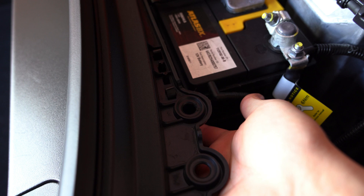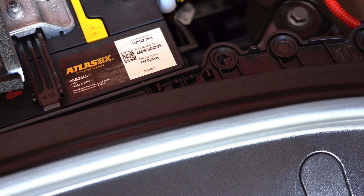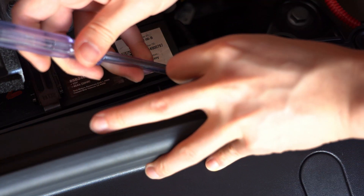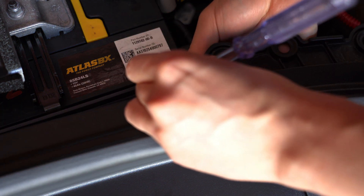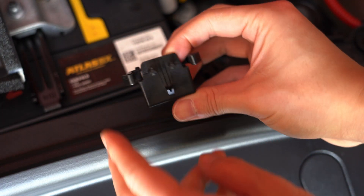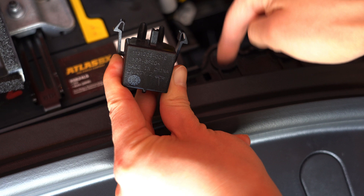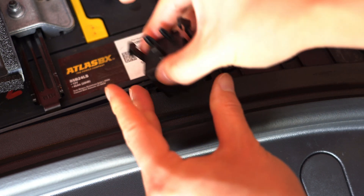So I'm going to remove this and show you what I mean and why it's broken. You'll need a screwdriver, and you want to basically release these two side clips, and then this thing will basically just fall downwards. So I press in on this edge — you do the same thing on both sides — kind of press in, and then this will fall downwards, and then you pull this down and the whole thing comes out.